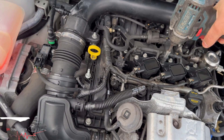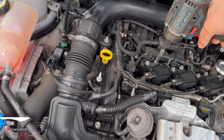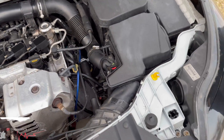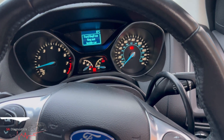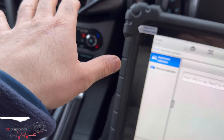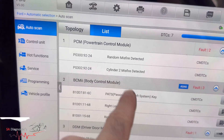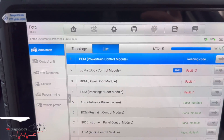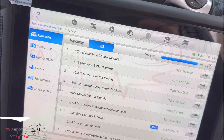Jobs are good and Bob's your uncle! The reason we've changed that is because the engine management light came on, it went into limp mode and there wasn't full power. I'll plug in the OBD scanner — as you can see, random misfire cylinder two, that's why we changed it. If we erase it all, everything's sweet and it should run as good as new.